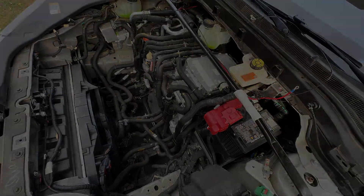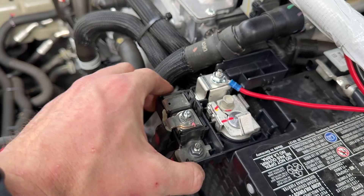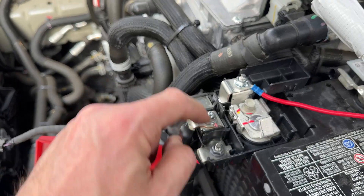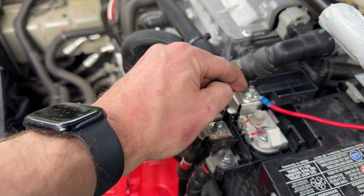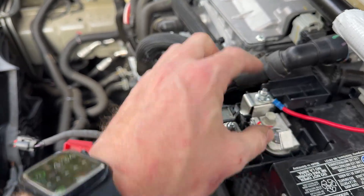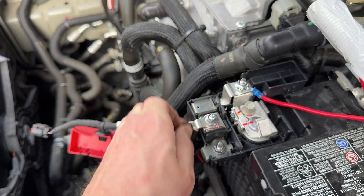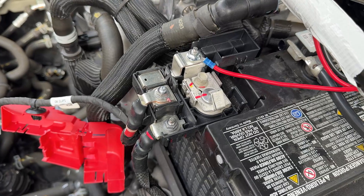Look at all this stuff in here. You can kind of see how this is all set up — this is actually what allows you to take it on and off of the battery. The rest of this is the harness, and it's connected to this strap. So I put my wire right under this particular nut here. You could feed it under either one of these as well, but I believe those are fused to some level and I don't want to take a chance in shutting down another module. This is directly off the battery, so I moved it over to here. Tighten everything up again and then bring the cover back over — the cover is a real pain to get off. There are clips here, here, and here — it's absolutely ridiculous. Be careful when you take it off, because I did mangle one side of the clip a little bit, but it'll all fit back on there. That's how you get it on the positive side. The negative side is actually quite straightforward.